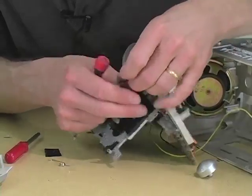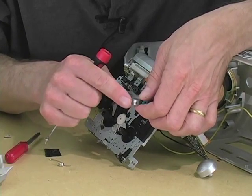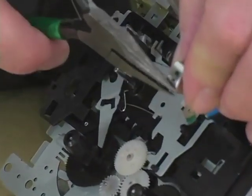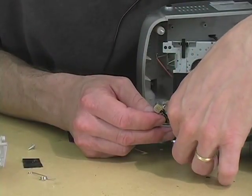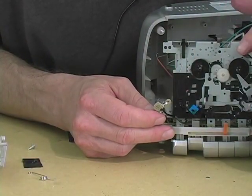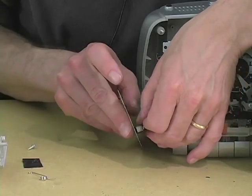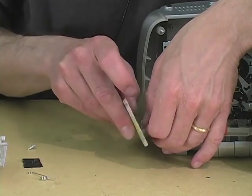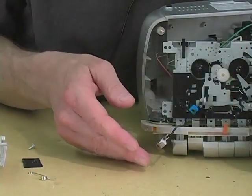There we go. On one edge of the tape head, there are two prongs sticking up like a simplistic fork, and these you have to bend back. They're used to align the cassette tape coming through, but they make it impossible to press the head flush against some other piece of material. If you press play on the deck and everything is still functional, little gears will whirl, and you can now take the head and rub something against it and hear the sound out of the built-in speakers. So now you have a self-sufficient playback device for hand scratching.